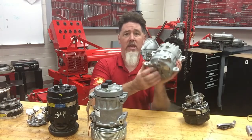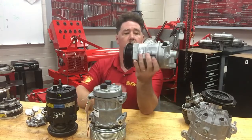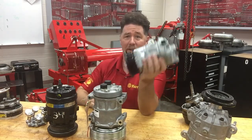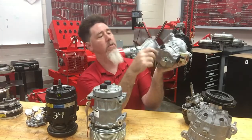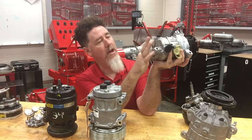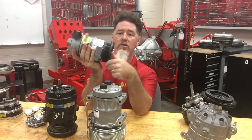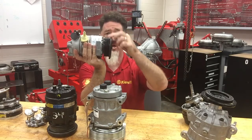Nowadays we're not using mechanical valves to control the pressure in the wobble chamber — we're using electronic solenoids. This is a fairly newer modern single acting coaxial compressor. The head is on the back; it's very light, about 9 pounds. It has a blow-off valve, and then there's a solenoid right here that goes fairly deep — that's my electronic solenoid controlling whether the wobble chamber builds pressure or not. Something unique about this compressor is that it is a clutchless design: it has a pulley and a bearing, but no clutch, so when the engine is spinning, this thing is spinning all the time.